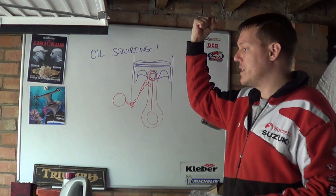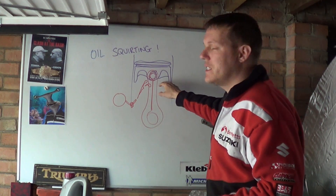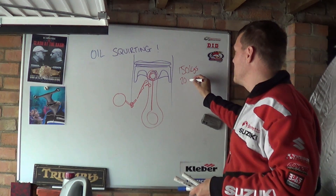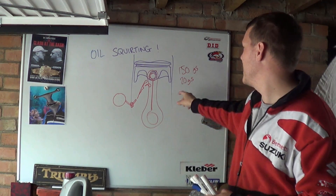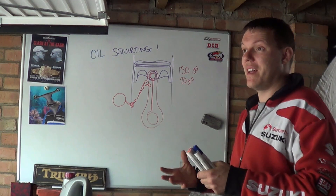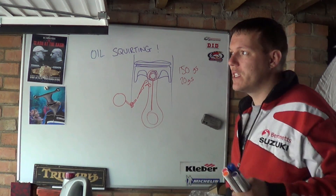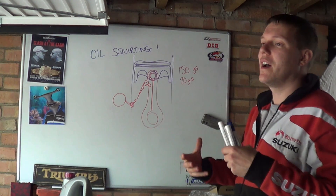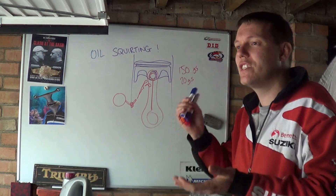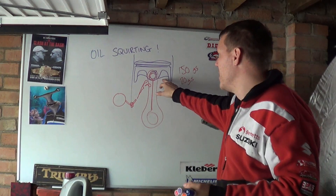Like I said before in a previous video, the piston doesn't go at 30 metres per second and then stops instantly — it actually slows down, gradually stops, and then accelerates back up. If this piston weighs, let's say 150 grams, you can quite easily add 20 grams of oil to the bottom of this piston. And when you accelerate that piston again, that is changing the mass of the entire system. When you come to the top of your stroke, you've increased the weight of your piston. When you look at really high performance engines — Formula One, MotoGP, stuff like that — you have to consider the viscosity of the oil and the stiction characteristics and the surface tension of oil on the bottom of your piston.